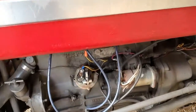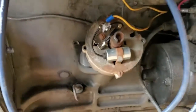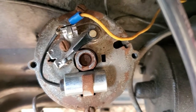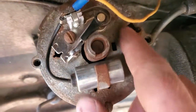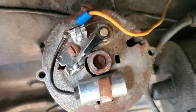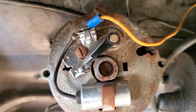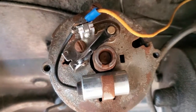Right away I think I'm able to identify the issue. As I was turning this over I had no gap in my points. How this works is you have a center cam and that cam has four edges — one, two, three, four — because this is a four cylinder. As this turns, you're supposed to have a gap in your points as it spins around. Right now I'm at maximum at one of the corners and I have no gap at all. So I'm going to replace these points since I bought the kit.